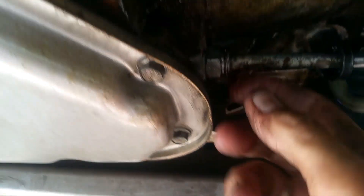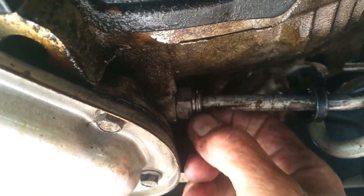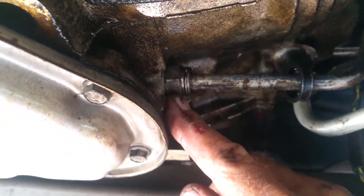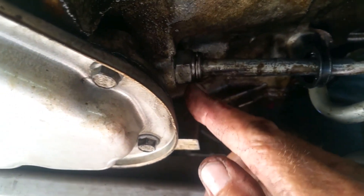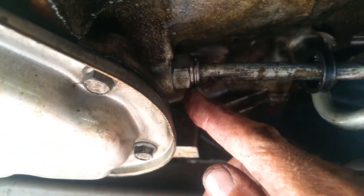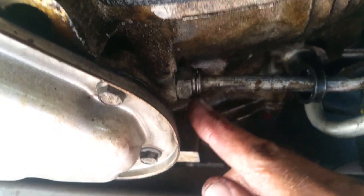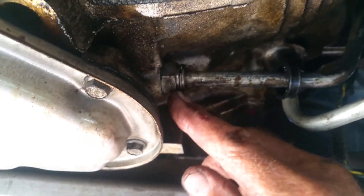What I did: I just took the little clips out of there — they slide out with a little screwdriver. Then this fitting right here, I take it off with a three-quarter wrench. There are two O-rings. I've got O-rings in my toolbox.